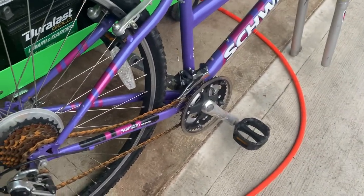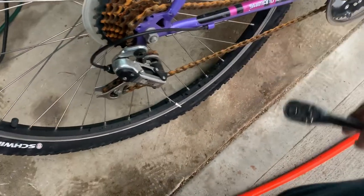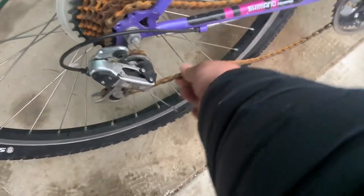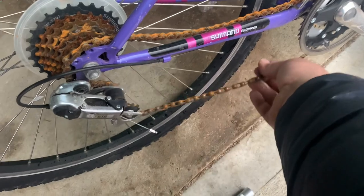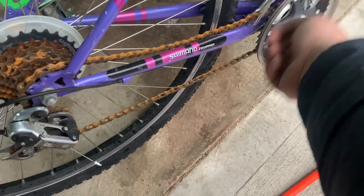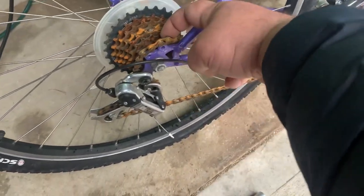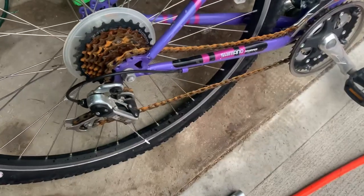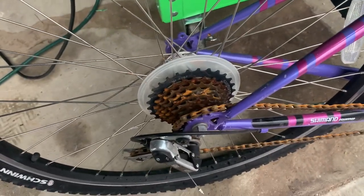You just need a little bit of tools and patience. The chain here — I always try to set it to gear number one and pull it back. The derailleur here, see how it has the slack? You can pull that up and feed it through, and it'll give you more and more chain to pinch back.